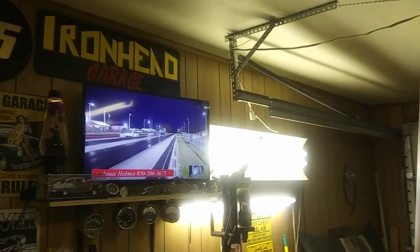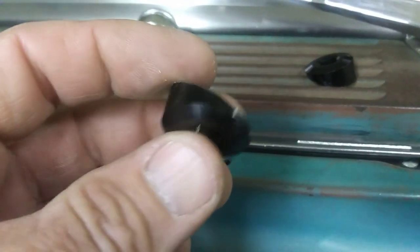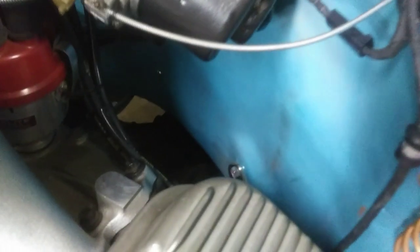Oh yeah, that's what a Nova and a Duster look like. So, I got that old bracket out of there and the new pedal bracket in. These shims they come with, I don't know what they go for. They're a joke. I tried to put them in there and square that pedal up, but then it leaves a big air gap. That way, though, I'd utilize the nuts that are welded on the firewall.